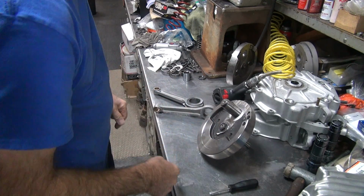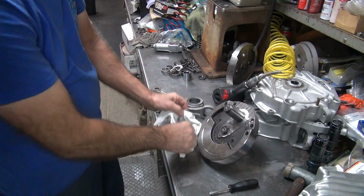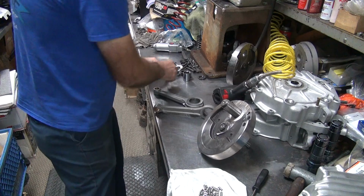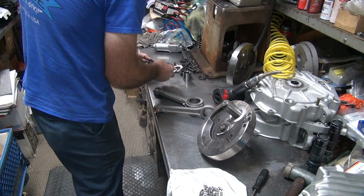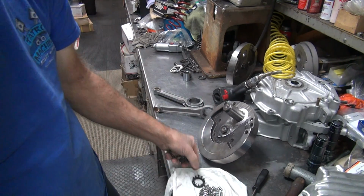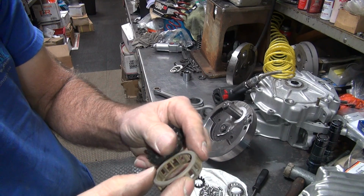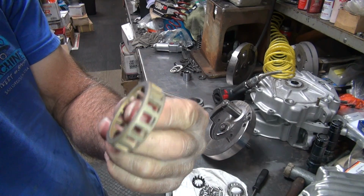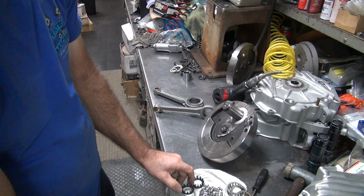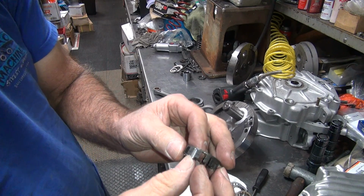Okay, so we're going to use Sportster bearings in this motor. So we have lots of clean bearings right here. Some go to the crank pin and some go in the main. Real Harleys have real cages that hold the rollers. Maple Leaf motors have cages that don't hold rollers, and they have fewer rollers and thin ones. Now these are steel, so they won't wear out, whereas aluminum ones are lighter, but they wear out. So your choice on which ones you want to use. We went with steel because we like stuff that doesn't wear out.